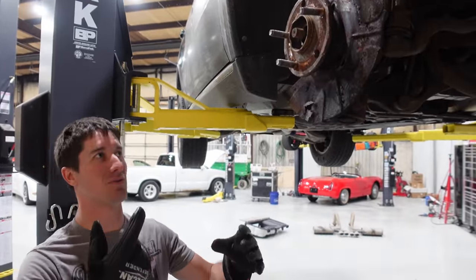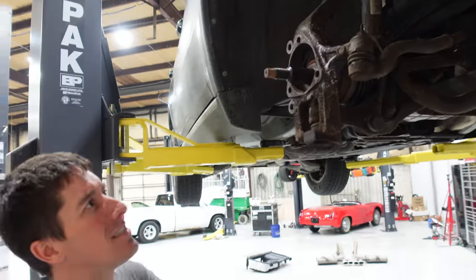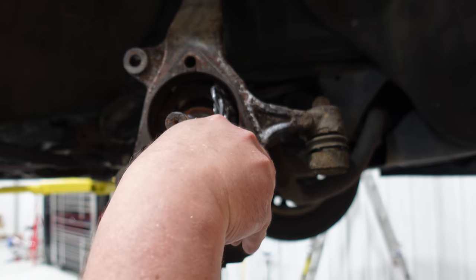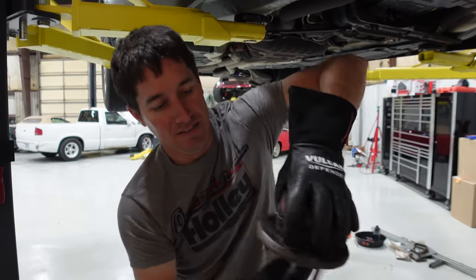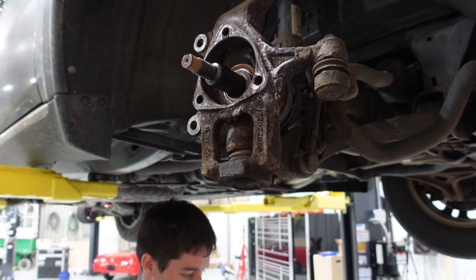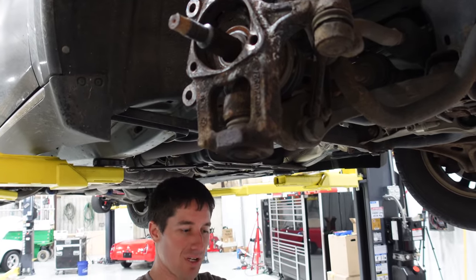The unfortunate part is now this one's destroyed, so it's definitely bad. We can't just spin it to see if it was the faulty one. Look at that — the ABS sensor is literally a melted pile of plastic. We need to clean up the inside of that upright with a wire brush. Just trash keeps falling out of it, right in our eyes. We've also got to bend the dust shield back into shape because nobody sells it.